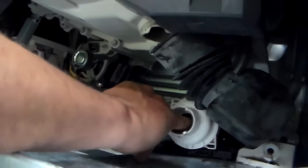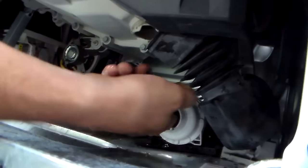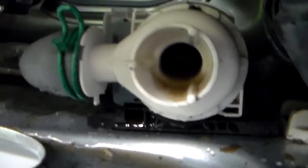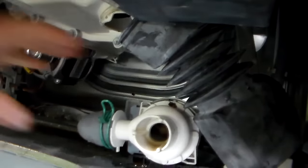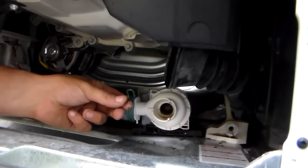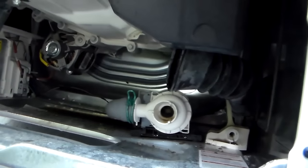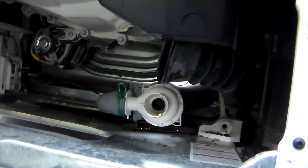Any one of these could have made it through one of these holes and got lodged down inside here. What I'm going to do right now is reach in and see if I can spin the propeller — and I can. There's a little propeller down inside here and it'll spin. Sometimes you reach in and you can't budge it at all. If you can't budge it, you're going to have to remove the pump. Let's say one of these items got inside, or you've got some strings or thread in there, and your machine will not drain — you've cleaned out your trap but you still can't spin the propeller. I'm going to show you how to take this off.